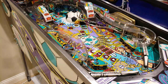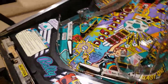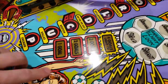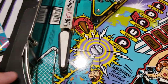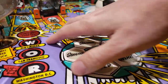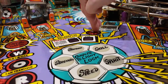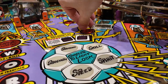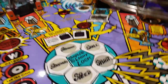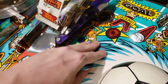That's really it. Let me grab my camera and show you a little bit closer on the game. One way you can always check is with some overhead lighting — you can really see the shine that was put onto the playfield came back to life, looking very dull with the dirt before. I feel like I've got pretty good coverage on it, and the playfield's in great shape. There's no extra residue. You can see right here with the pop bumper stars — if you use more of a traditional or cheaper wax, these will get all gummy with lots of residue around them. When you buy a little higher quality of wax, you won't get that. There's actually not really any residue there — that came out pretty well.